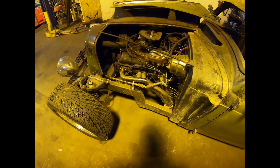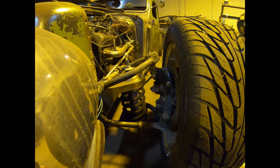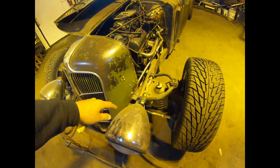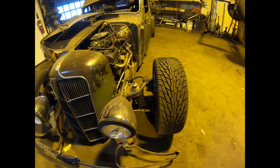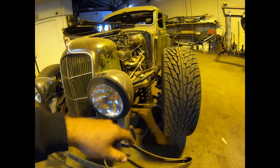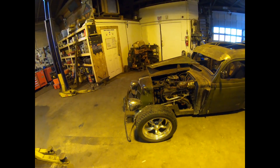So the steering needs to be completely redone and the frame definitely needs plating and gussets up front. There are other problems too - they cut the springs down, the upper control arm is way up in the air and needs to be addressed. This kit is definitely not installed correctly. Because the spring was cut so low, there is zero suspension right now - the shocks are actually holding the car up, completely bottomed out with pretty much nothing for suspension on the front. We're going to have to cut the entire front suspension out and redesign it.